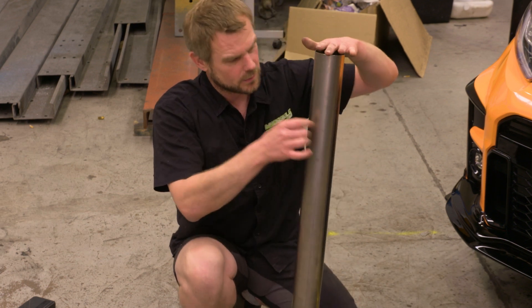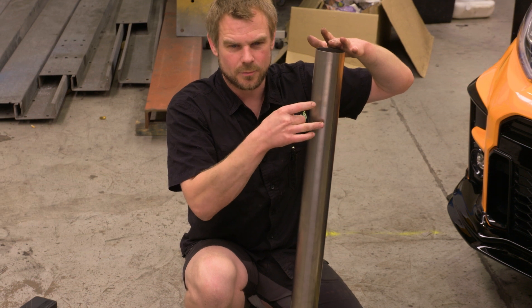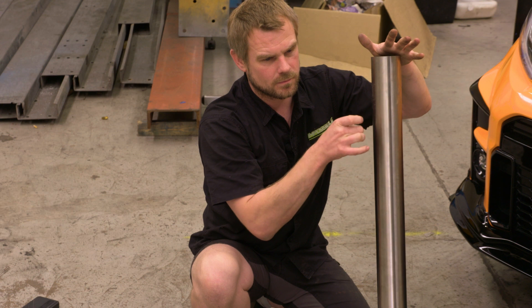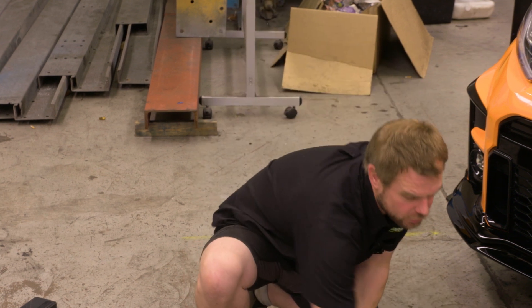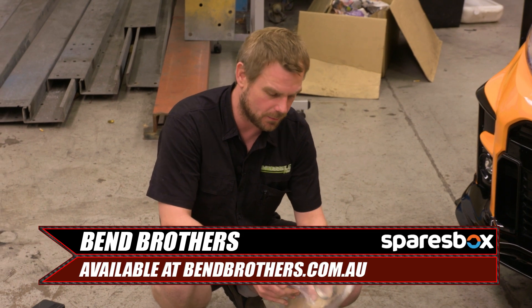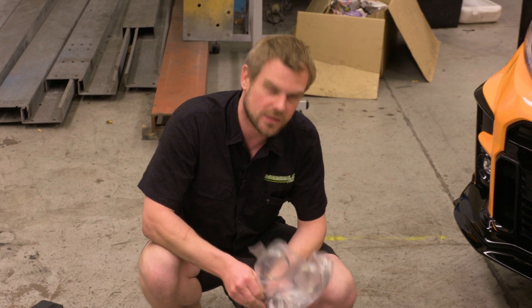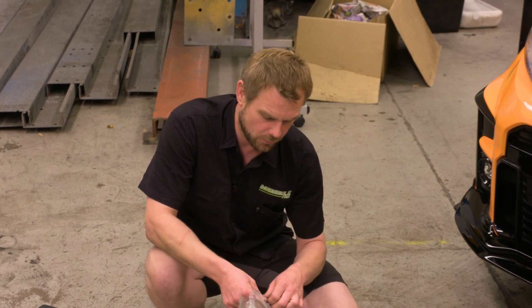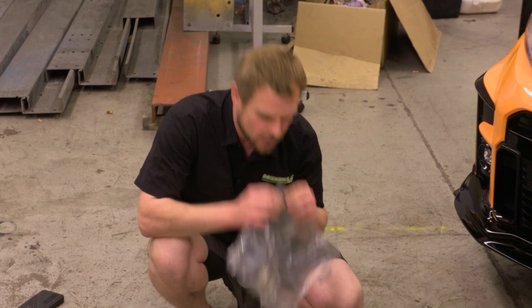With our system today, we're not going to have any mufflers. So we're probably going to make the worst sounding Yaris in the world, because of the resonant frequency that comes out of titanium. It's really tinny because the metal is only one millimeter thick. The stainless steel has quite a denser sound by comparison. To save time — because titanium is very hard on cutting equipment and you have to cut it really slowly — our friends at Ben Brothers have hooked us up with these pre-cut laser-cut pie cuts.